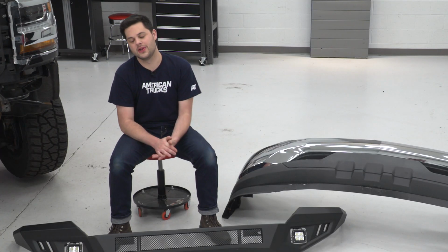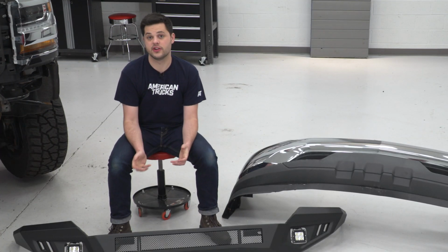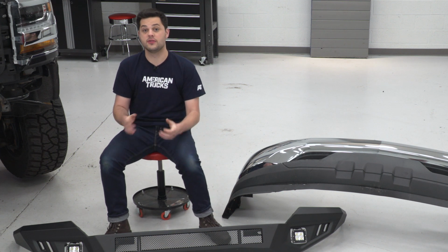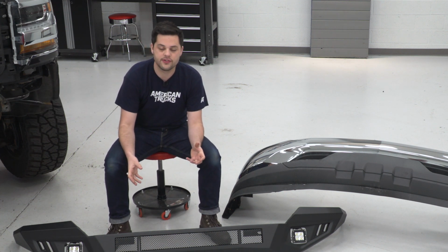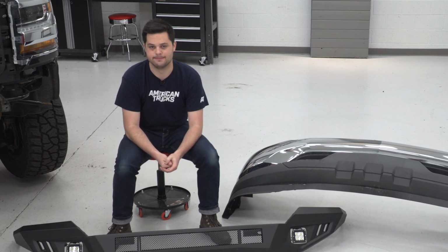So now this bumper is ready to be installed. We're just gonna grab the 15mm hardware that we uninstalled off the plate on the ends of our frame rail earlier. We're gonna hold this up and get it in place finger tight.